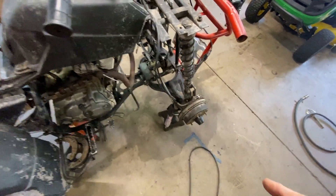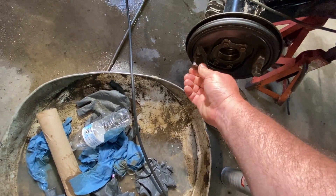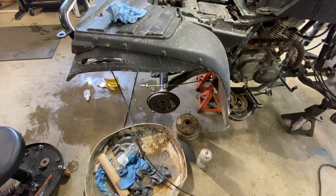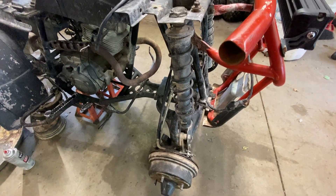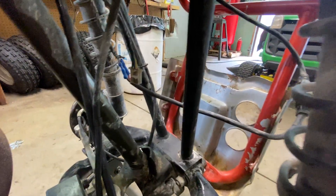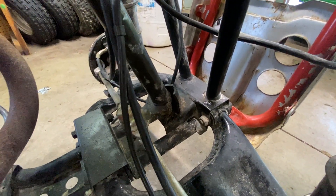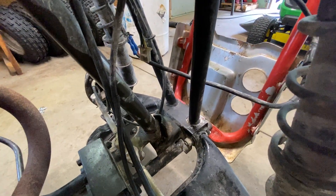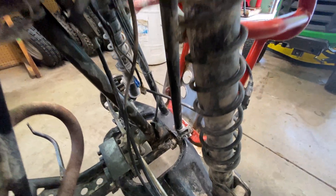The front brake cables — these little ovals that are part of the lever that rotate to widen and close the brake shoes — both of those are frozen up. The front cables are frozen. Everything was just rusted, mold, and muddied together. Getting those all apart and cleaned up took a while. I can see the movement there isn't actually coming from the rod ends — it's coming from the pivot point. There are a couple of bushings in there that look like they've never been greased, full of sand and mud, which acts as an abrasive and wears the brass bushings out. So two bushings are on order.